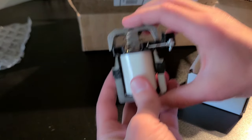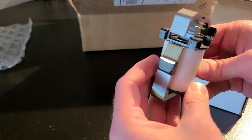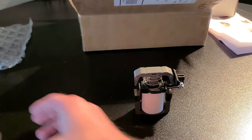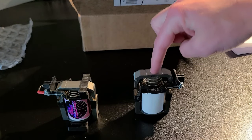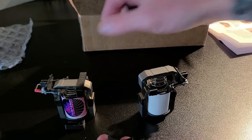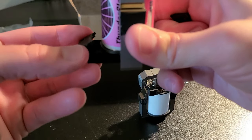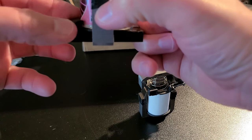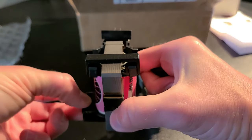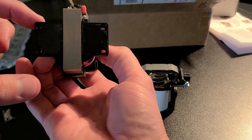So you can see there's one in here — that's all that comes in the box. It doesn't have all the mounting accessories on it. The Doghouse Arcade label got hot from delivery in the sun and was coming off, so I took it off, but this is what you can expect when you open it. I'll put this right up to the one that is already completed. You have a crossbar on the top that stops the core from coming out, a mounting plate on the bottom, and a couple of little extra fins that hold the bottom ring of the coil down. When you put the mounting bracket on the bottom, it sandwiches it in so you can use these holes to drill into the cab and secure it. At least two of the holes on the bottom bracket line up with the original Siemens contactor holes, though it's a little narrower.